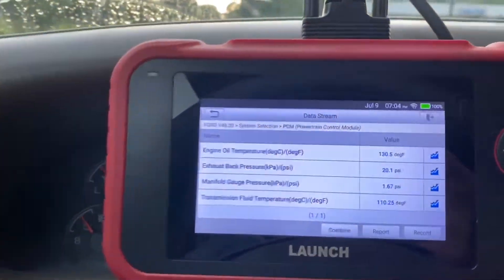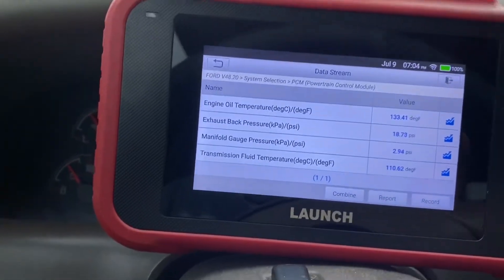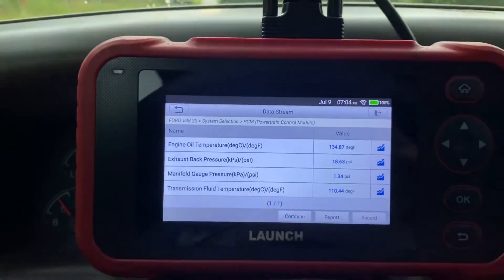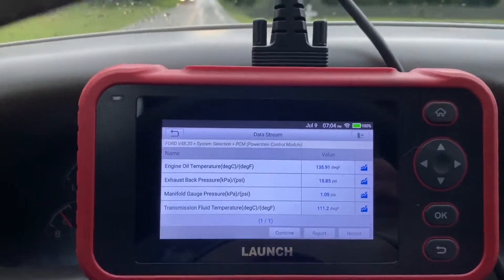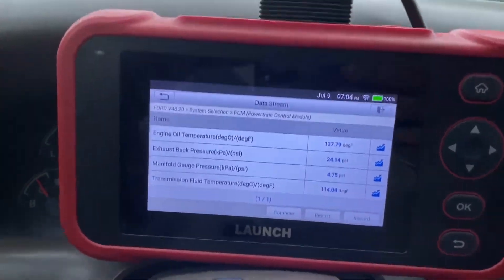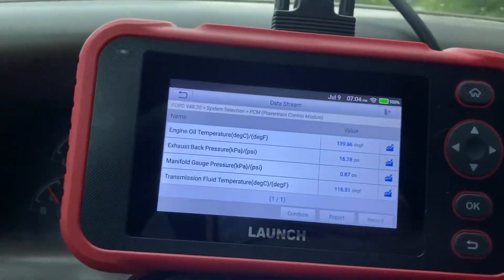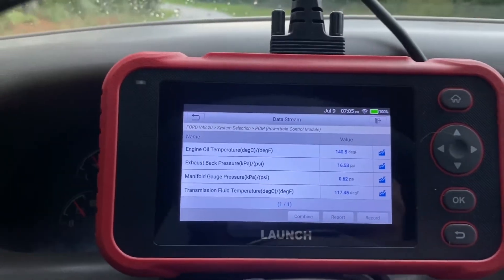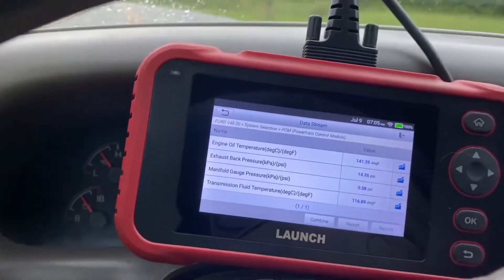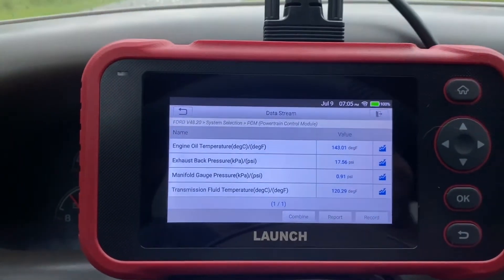We're taking this thing for a little test ride and it feels like a completely different truck with the tuner on it. Of course it's reading back pressure now. On the 75 horsepower tune, just part throttle is unbelievably better — it's crazy how much better it does. We've got a little boost pressure showing. Even at five pounds of boost and part throttle this thing feels a ton better. Some of it could be because the back pressure sensor was malfunctioning — that could be why it felt so laggy. Overall I'm freaking stoked. We'll see how it does pulling — hopefully we'll be racing at Thunder Valley on Sunday. Y'all come see us. Don't forget to comment, like, and subscribe!